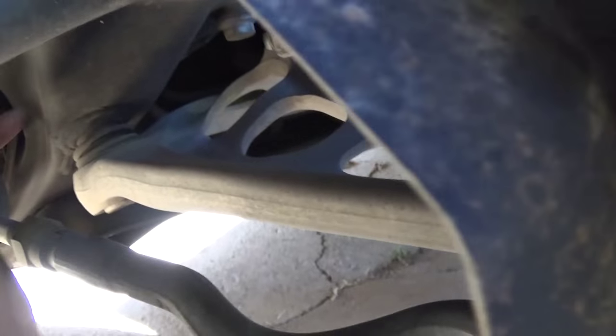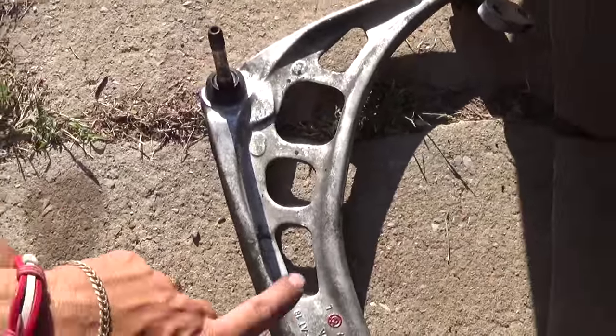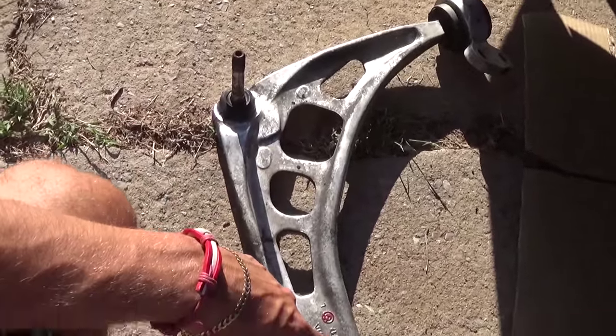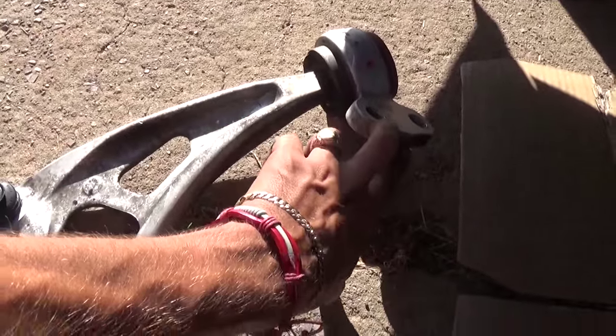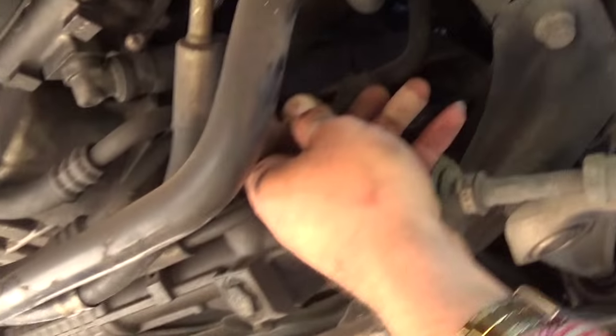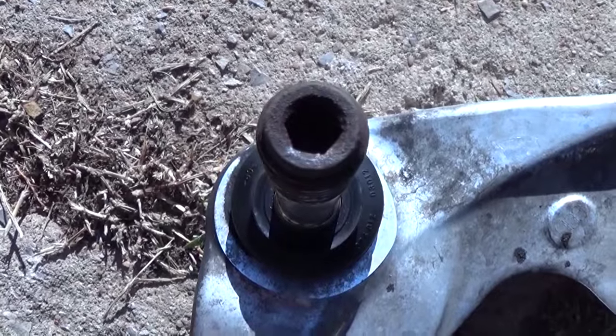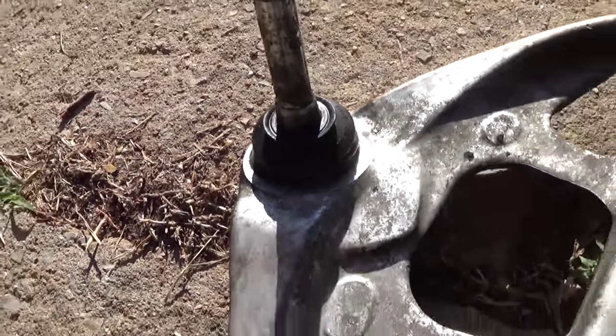Now with a 22 millimeter or seven-eighths inch wrench, that's where the other bolt is — that's the control arm and that's where the bolt is. This is the replacement control arm we have: the two 16 millimeter bolts are right there, and this is the one we're taking off now with the 22 or seven-eighths. When you remove the plastic engine cover you can reach it from right there. If it's spinning, you need to use a hex key in the middle to prevent it from spinning so you can take the nut off.